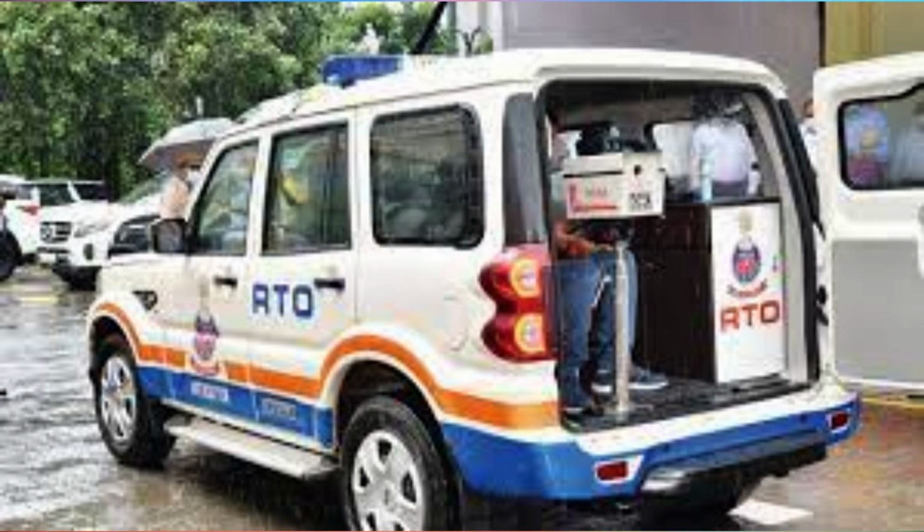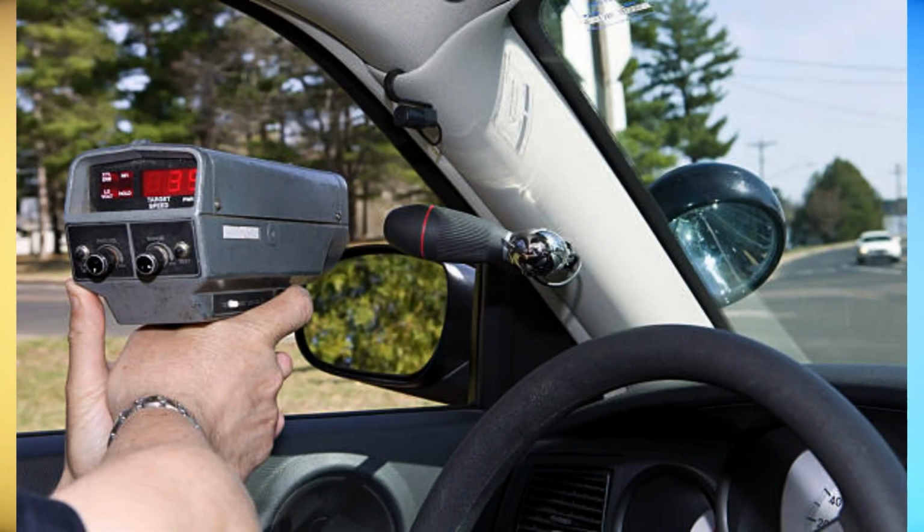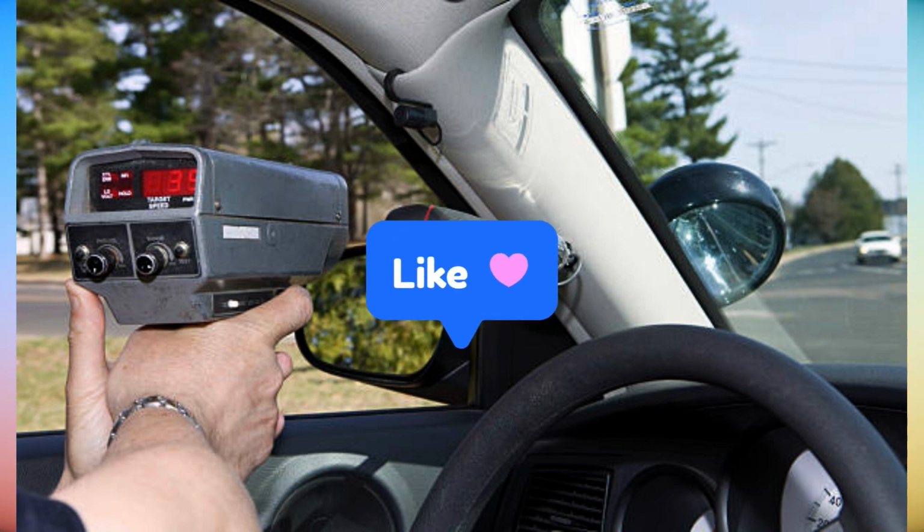The second method is by using piezo sensors. This method uses a set of 3 rubber strips with specific distance apart, built across the road or buried in the road. The time between compressions is measured to give the resulting speed of the vehicle. If the speed exceeds the limit, the camera associated with the system will photograph the vehicle.